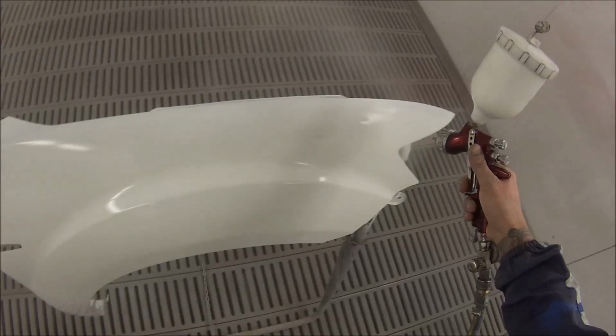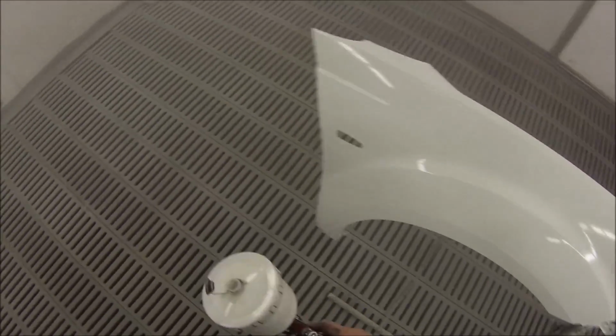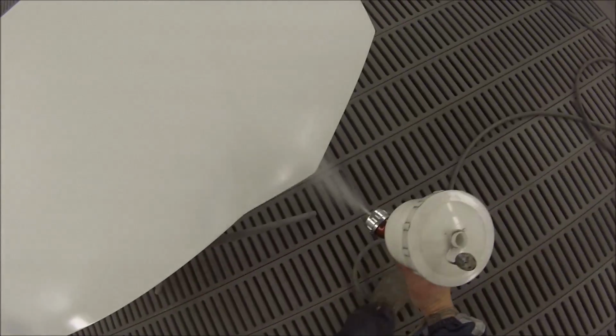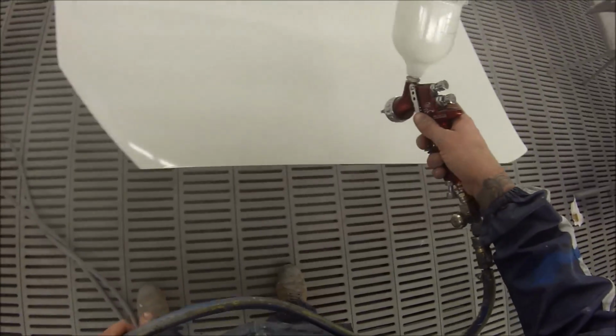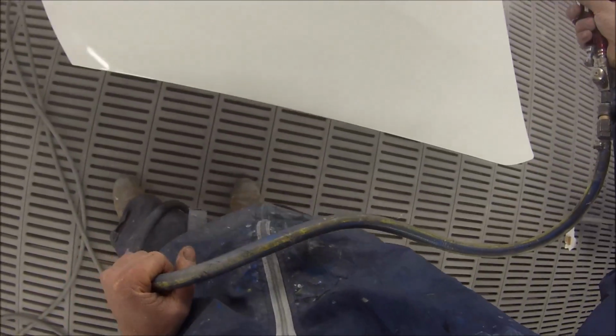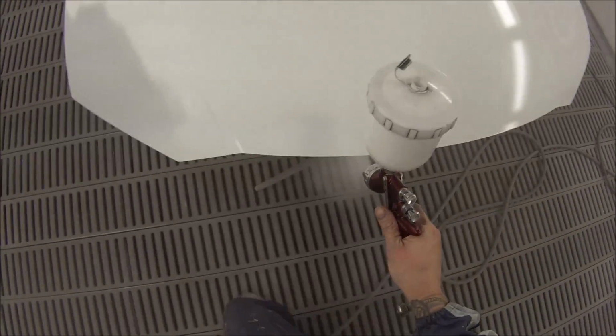So this is pretty straightforward. This VOC is just like clear coat really. You put the one coat on, then leave it for 5 minutes and come back and put your second coat on. So what ended up happening on this bonnet was, for some reason, I don't even know why it happened, I did every step correctly. I filtered the paint into the gun. As you saw, I blew the panel up extremely well, and for some reason there were these tiny little spots throughout the whole bonnet. They weren't silicone holes, they were like high spots, tiny little bits of dust landing in it.